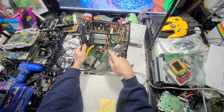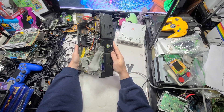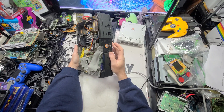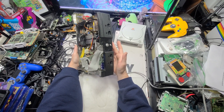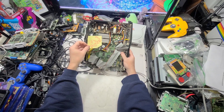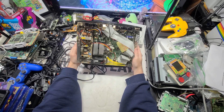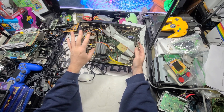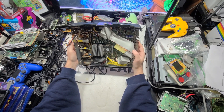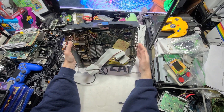There are motherboards that do this — some other on and off issue where it just never stays off. There it goes again, turns on automatically. That's kind of what trace rot looks like. Normally the trace rot off version is where you can never turn it on and you think it's your power supply. So you go buy another power supply and it doesn't fix the issue, and you return it saying I sent you a bad power supply — but the power supply is fine, it's a button issue.